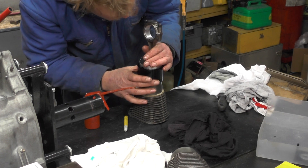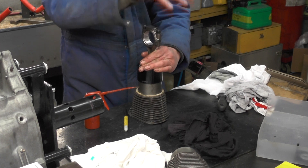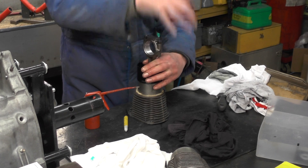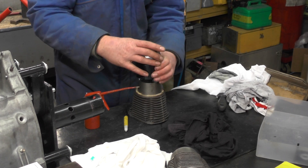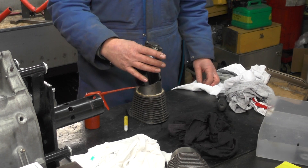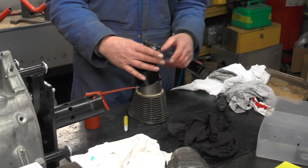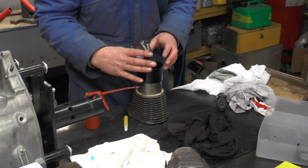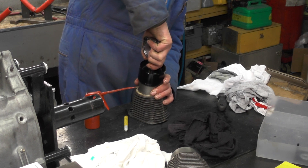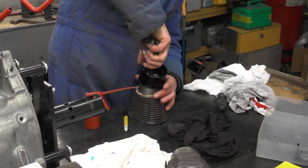So your circlips are all correct? Yep. Oh, so much easier. Is that going to come up? No — so you've got to take the con rod off, fit them through the top, and then fit the circlip on. Yeah, like a Porsche, which is not a problem. Never thought about that. Caught me off.